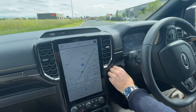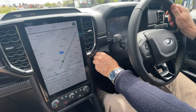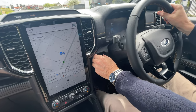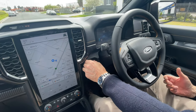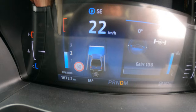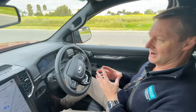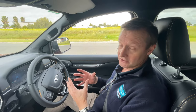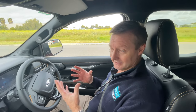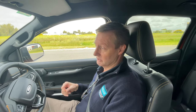So why do we have a pinch control? Two reasons: firstly, to set up our trailer gain correctly — we pinch it on and ensure the brakes are working and slowing the car down. Normally you do it at 60 km/h to get good retardation at that speed. At low speeds it's harder to get the exact feel. There are a lot of cars bought for towing work that have DVD players installed, and you think — how often do you use a DVD player? How often do you need an electric brake controller if you're towing a work trailer or a caravan? All the time. So it's good to see Ford has put some priority into these features.